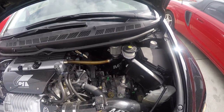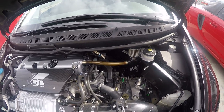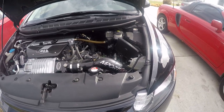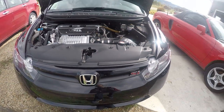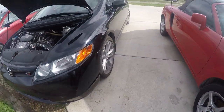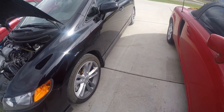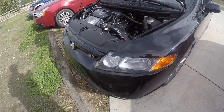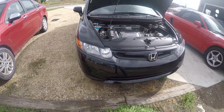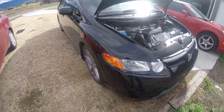It's just awesomely clean. It's got a catch can, a lightweight crank pulley, an Exedy Stage 1 clutch, and a 9-pound flywheel. It also has Synchrotech carbon synchros to fix the second gear problem that comes from the factory — unfortunately second gear grinds and eventually fails. I've got that rebuilt and it's shifting really, really smooth now.